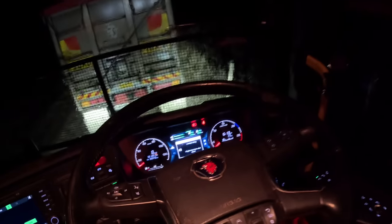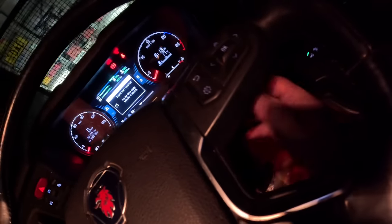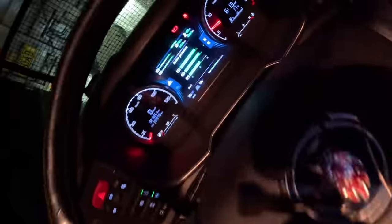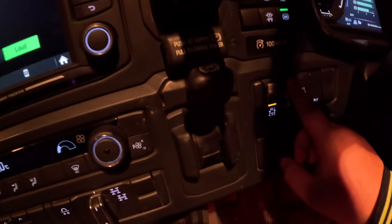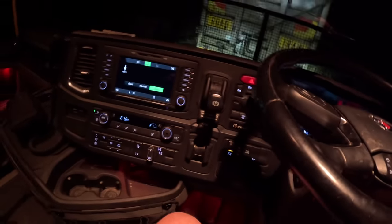First things first, in order to lift the trailers down on this lorry, you've got to start the engine. Then you've got to lift the revs, so you do that. Lift the revs up to about 600-700, and then you turn the PTO on, which enables the truck hydraulics to activate. And then we've got a special little remote here which can be used to lift it up and down. So I'm going to hop out and do my walk around check now.